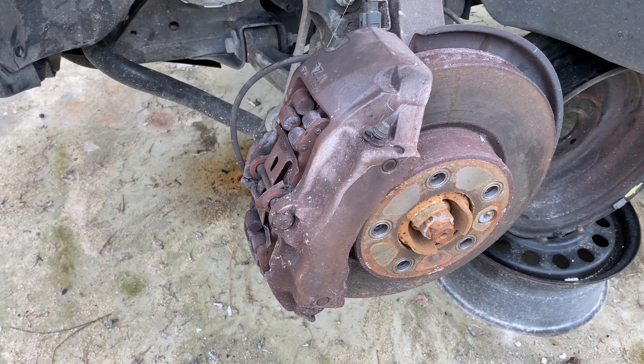The front was a success, pretty easy. Those bolts are like 21 or 22 millimeters, bigger than the lug bolts, so luckily I had those with me along with the impact gun. The rear is just a little bit of a struggle — I didn't have the star key. I think it's like a T12 or T13. I only had a hex 12 and it kept slipping, so I just prepped everything. I'm going to run down to Harbor Freight and grab a star set and see if I can get it off.